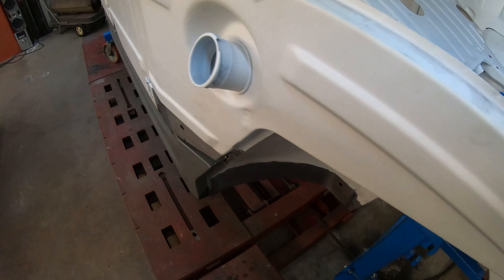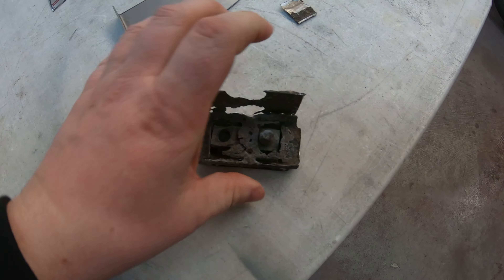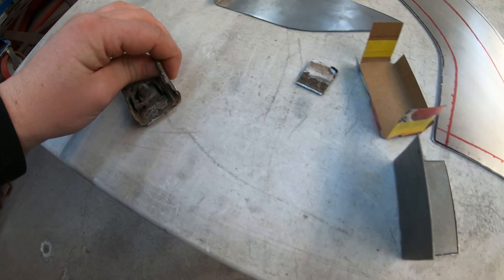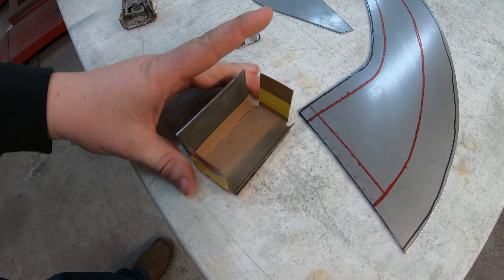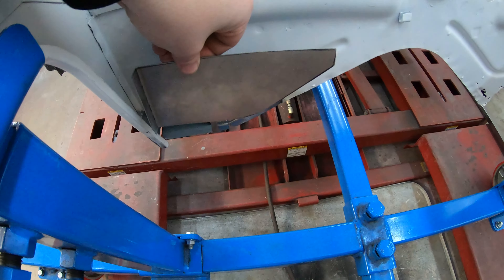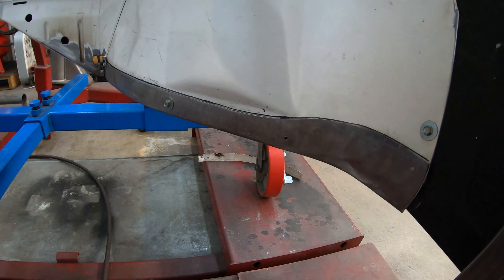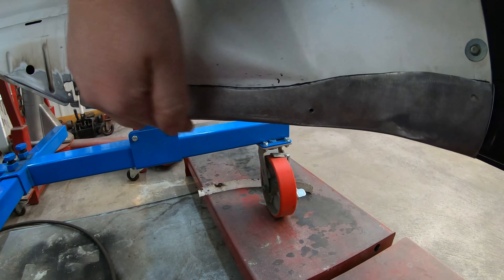So it looks like that on the inside also. The box in the front has been removed — the box that was right in here — that's all been pulled out, and we got the box right here so you can see how rusted that was. This bolts for the beam support that bolts into here. And then this is the new box — you can see there's a couple different pieces here. This is the bottom plate, and then this is the template for the other box that's gonna go on it.